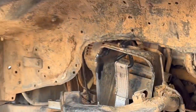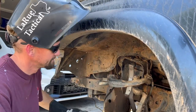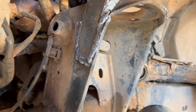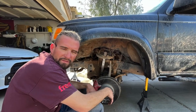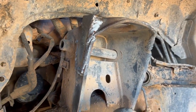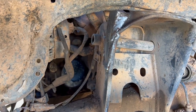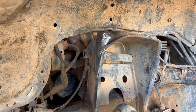She's full. We're gonna put the strap on the other side. I'm gonna cut a little piece of metal, probably tack one side, bend it around a little bit, weld her up. That was challenging to get the welder in there and it was not clean, so it's ugly - but if I would look at this thing I would just say, yep, that's factory. Ain't pretty but I think she'll hold. It's gotta be stronger than it was, right? Tell me it's gonna be stronger than it was. We're gonna roll with this on this side, put the A-arm back in, put the strut back in - just do everything in reverse - then put some paint on it and call it good, and we'll do the other side.